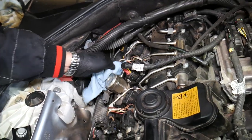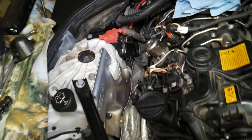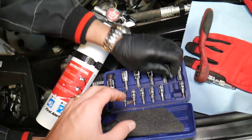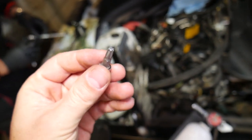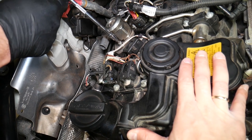Some fuel is still leaking out, but not terribly bad. Next, we need a Torx T30 star bit. We'll have the link in the description below so you can see where to get all the tools and parts. Now we'll remove the two bolts holding the fuel pump.